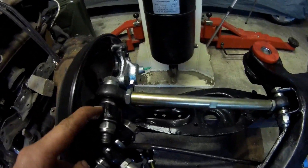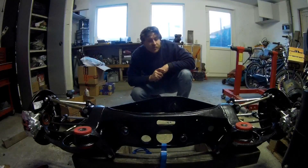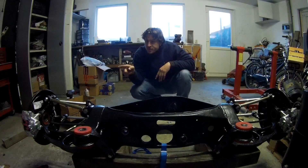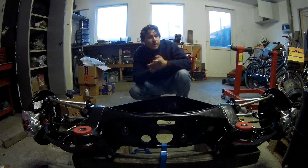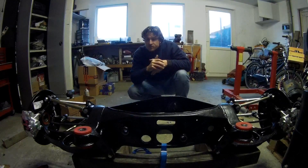The holes in the hubs were also drilled up to M14 — all of those holes. So the subframe rebuild is completely done — rear ends. If you've got any questions about this subject, leave a comment below and I'll try to answer. So, S210 rear hubs with E55 AMG brakes — the S210 has bigger diameter wheel bearings and hubs, that's why I use these. You need to modify one part on the bottom side of the subframe — three centimeters backwards. If you've got those hubs next to the original one you'll see what you need to change. Do your own measurements — don't fully trust mine, I just did it this way. It's the same method I used on the 190.